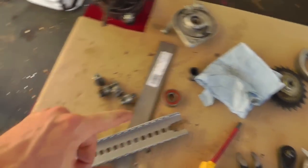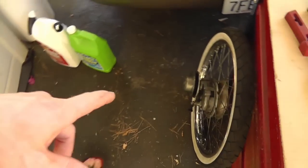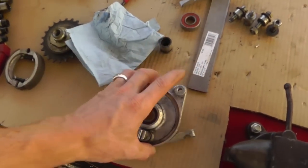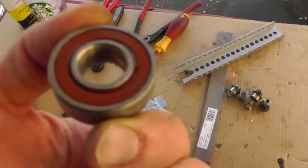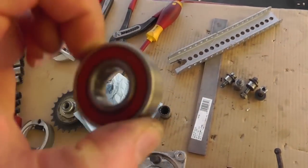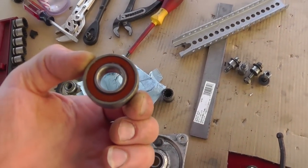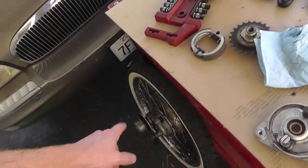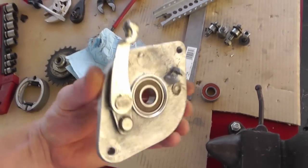What's up everybody, Russ with RWG Research, doing a little bit of work on the Honda Hobbit. When I took this apart originally to fix the gearbox — put a new gear in the gearbox, put tires on — I found out that the bearing back here was bad. This is the original bearing, a 6202LU metric bearing. It felt pretty bad. I took it apart, tried to clean the grease out and put new grease in, which helped, but I was concerned because if this locks up and ruins my shaft, I'm screwed.